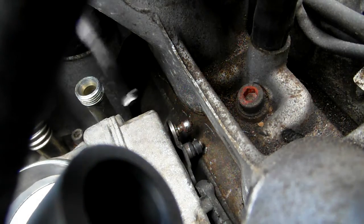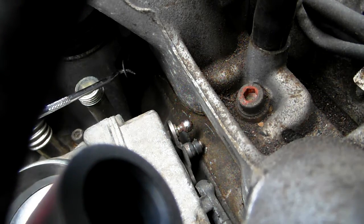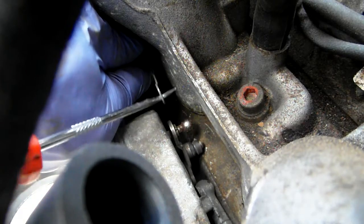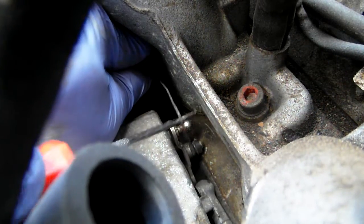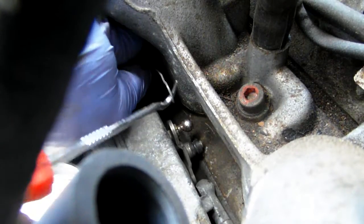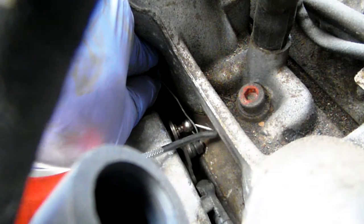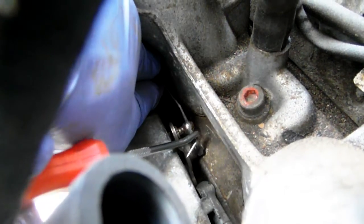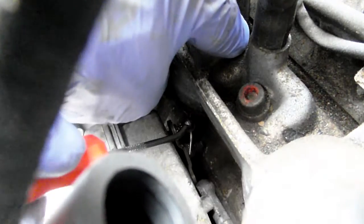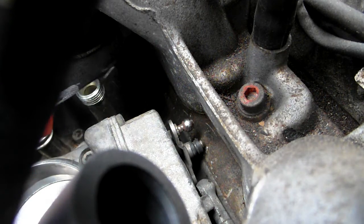I set this piece down so it's not in the way and I'm gonna try to latch it on. See, that's what I mean - if it shoots out like this, there's a big chance of the spring being lost. And if it dislodges and disconnects right now, it's gonna take me quite a few hours to get this thing back. I have this pick and I'm trying to work the spring down - first set it down onto the ball; it has to go on the bottom piece.